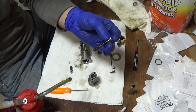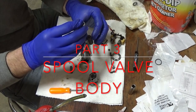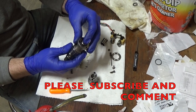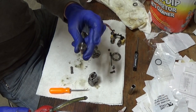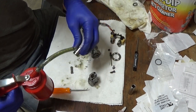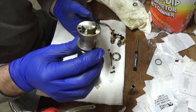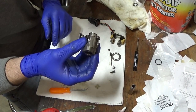I put a little lube on the plunger so it's not dry, put it in the spring, wiggle it a little bit to get it in there. Then you've got the plunger hat — put a little lube on it all the way around, just let it slide on top. I always leave the excess lube on there; it helps the spool valve body slide on.